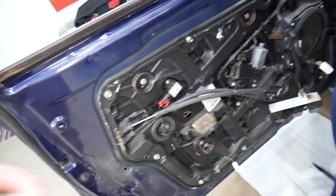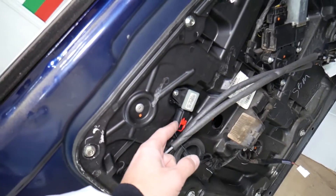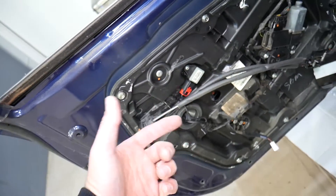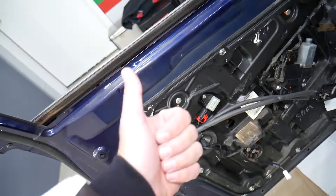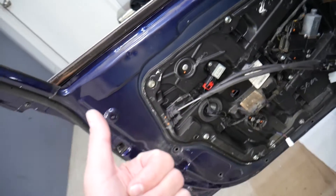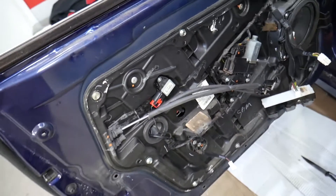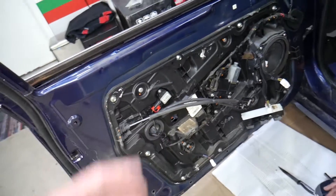For the next step, it's important to disconnect the car battery and wait at least one hour. That's the side impact crash sensor right here, and we need to disconnect it. Every time you work on airbag sensors, have the battery disconnected for at least one hour so the computers can discharge. If you're not qualified and certified, I don't recommend working on airbag sensors.